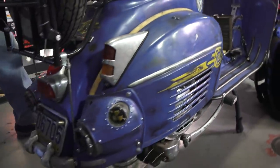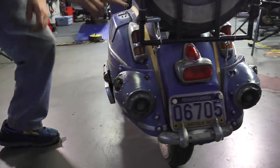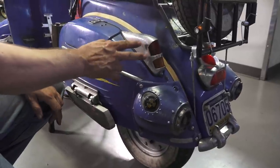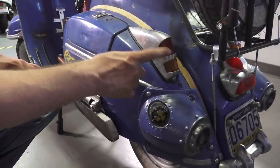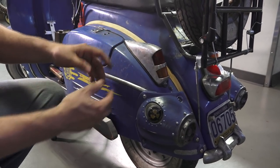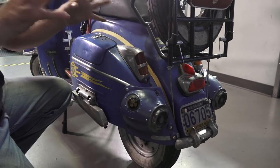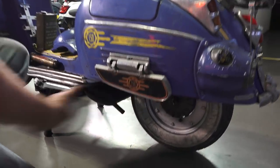The graphics were so much fun — I've had many people ask me to make graphics for their own bikes. The lights are super cool. These were some JAG lights — not expensive, about 50 bucks online. They came with a red lens and a basic light holder. I wanted to add turn signals, so these are now brake and turn signal combined. I cut a yellow lens in half, glued it to the red lens, and inside are two LEDs. They're set up with running light, brake light, and turn signal functions, so people know you're actually stopping.